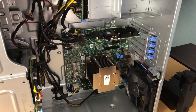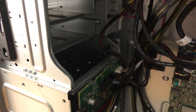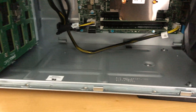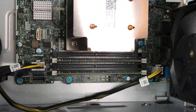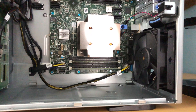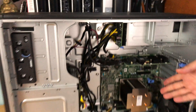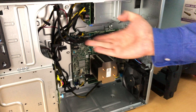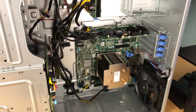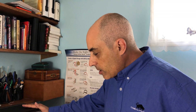If you go back to my other video of the R640, you'll notice a lot of memory slots. In this case, right below the processor, there are only four slots. We've got 2×16 GB of RAM. This server is going to be running VMware, but only a very small VM, so there wasn't need for a lot of horsepower. The processor is an E2288. You've got the processor, memory, and RAID controller going to the two front drives — all that's left is to power it up. We're going to be putting ESXi version 7 on here, which will be running a Windows Server on top.